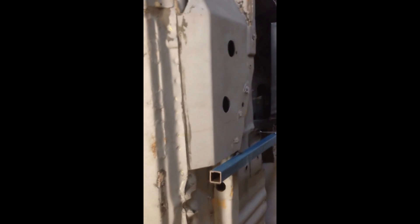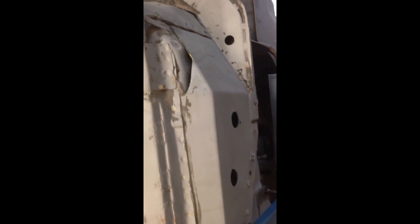The front arch is buggered, so we've got some old arches cut out of another car which I'll tack into there and blend them in. The rest of it is actually not that bad at the front — it's got a skid pan on the driver's side which looks like it's from factory, built into the arch and inner sills, with some nice posh spot welds. Unfortunately the other welds on it look like Stevie Wonder did them, but we can grind them off and redo those.